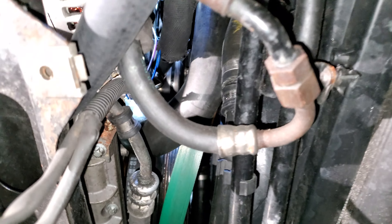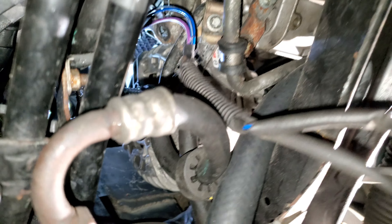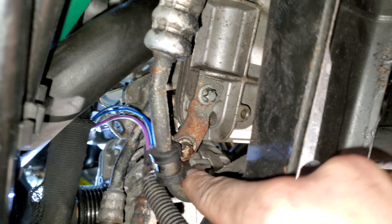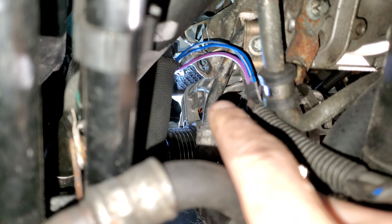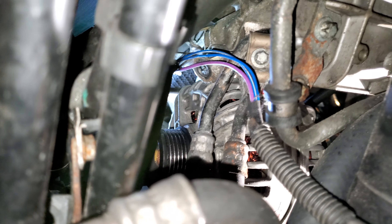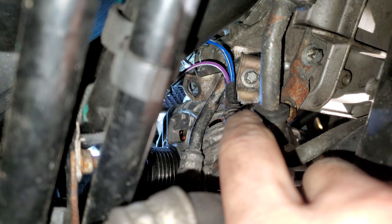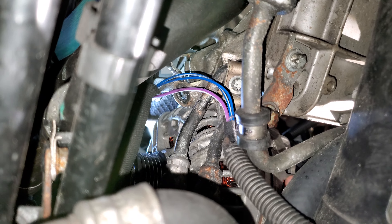I got my safety stuff here. So if we go underneath here - bear with me guys, this is weird angles. This is the harness right here which I just fed out. It goes back underneath here, and these two lines going up right here - there's that little double one, and then there's a big one that goes to the bolt that goes against the alternator. It's a really tight fit. You have to loosen that up because this wire goes up around that, back around it, and then underneath and all the way over. I had to push up on the alternator itself a little bit to get the rest of it out. But now they're just dangling straight up to the top out of there.